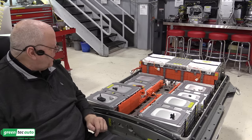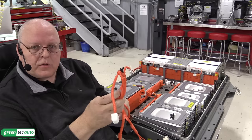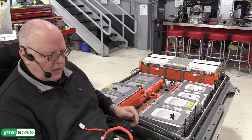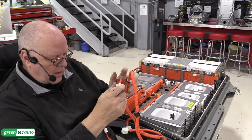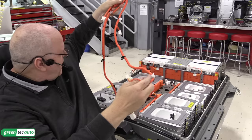And now the next thing to do is bring in the battery heater wire harness. Okay, this is our battery heater wiring harness. And it makes a connection, of course, with every battery heater. It makes a connection up front here where the junction block with the contactors goes, because that's where it receives its power after the contactors are enabled. And then we have a controller that is going to control the heater that plugs in also. So let's get this set in place. The power source harness side, there's a left and a right side here, has to go on the driver's side.